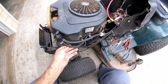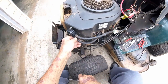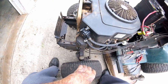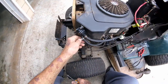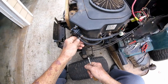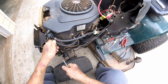Sometimes an engine would stump me. A boy brought me a little mini bike — somebody had given it to him and it was completely disassembled, and that boy completely reassembled it himself. He said he couldn't get it running. I said I'll figure it out — there ain't much can go wrong, it's either getting no fire or no fuel. I checked everything, it had spark. Every time I'd take the carburetor off and clean it — I cleaned it two different times — I'd take this little nut out of the bottom and lay it down. It had a little pinhole in it that I didn't see. It took me a while to find that. When I got that pinhole cleaned out, it ran like a champ. You learn a lot of things on the job as you go — you don't know until you actually do that kind of work.